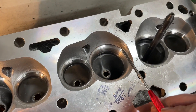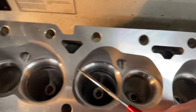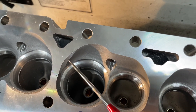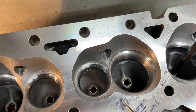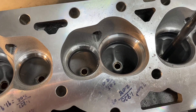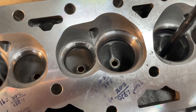Also, just to give you an idea how aggressive that top cut is: when I'm cutting the valve job you can see the spots here, and over here and here — that's where the top cutter is actually hitting first before it comes down, so it's moving around. That's my first thing I thought I'd show you, so hopefully it gives you some more information. I'll tie it into the next stuff — hopefully the next video you see is me flowing it with no port work done, just the valve job.